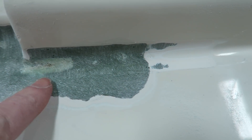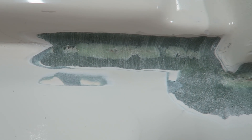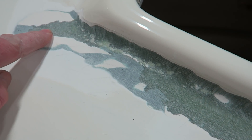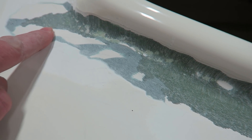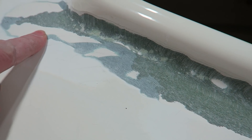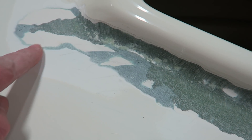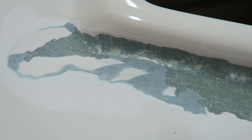So now with a few of these areas opened up, let's take a closer look and really see what's going on. The first thing I'm noticing are these little white spots that I'm pointing to here. These are basically air voids beneath the glass. Whenever you're dealing with any kind of a radius, those are actually very common during the original layup process. So I'll likely be chasing those all around the perimeter of this hatch as well as this forward deck. The other thing I'm noticing is the lack of fiberglass. When I was doing the grinding on here, I just went down until I hit some of the original layers of glass, and at that point I just stopped — I didn't go any deeper. So when we're looking at the different layers here, the green — that's the original glass layup from when the boat was built. The grayish stuff is typically a polyester-based filler with some glass hairs mixed in with it — basically a glorified Bondo.